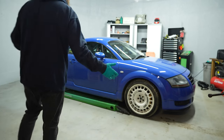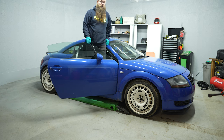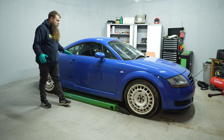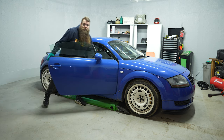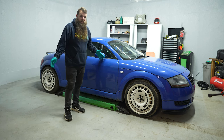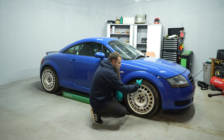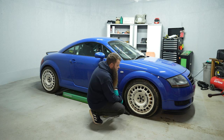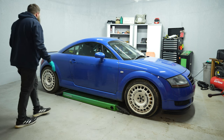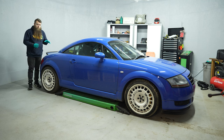So what do you think? It's down. Whenever it's been lowered or had any suspension work, it's always a good idea to go round the block, maybe check nothing rubs first. It's certainly a lot more steady than it was before. Now it's completely down. I'd like to take it for a little drive and let it settle. The all-important test — it was four fingers before. It's definitely not four. It's definitely not three. Two fingers — perfect. So we've taken off probably an inch, which is the perfect gap. If you stand and look back, it sits absolutely level. Two-finger gap at the back, perfectly flat.